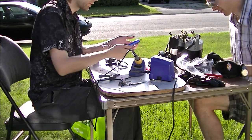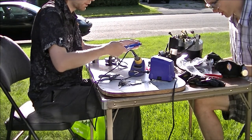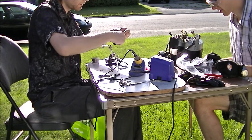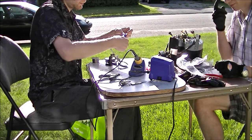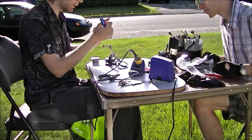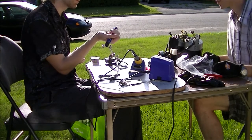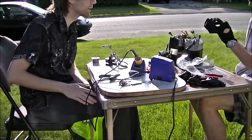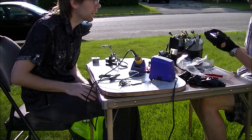So it's literally just a plunger. Okay, and that goes right, a little latch. So safety glasses off. Yeah. So you push it, and then you melt the solder that you want to suck, and you put this near it, and then you suck it up. Cool. Getting it pointed at exactly the right place takes a little bit of practice.